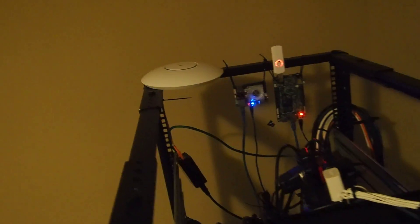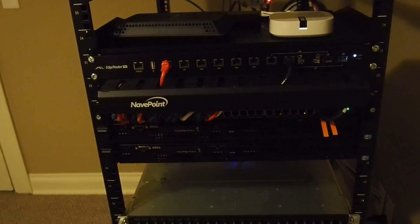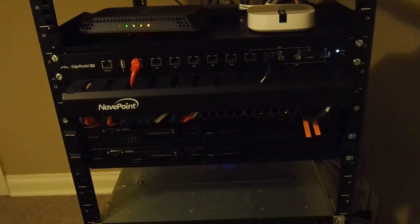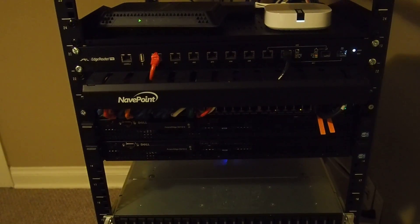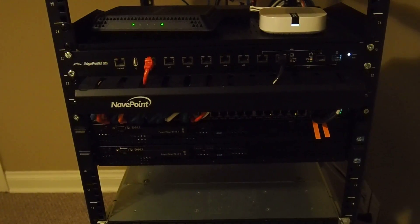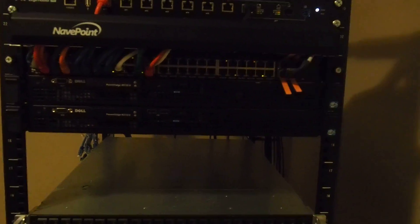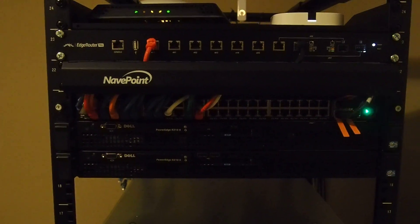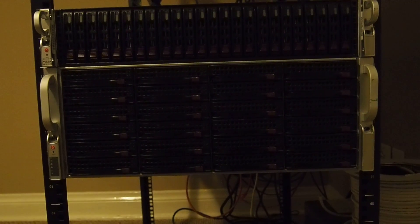By flipping the switch you can see the lights — the switch fans are the ones spinning up; they will quiet down. It's about 10 o'clock at night and the internet's been out for the past eight hours, so I'm not going to wait until morning to get everything powered on. You can see some lights blinking on the side as it loads the config — and the switch is initialized. Next, I power my storage box before my hypervisor because of NFS mounts.